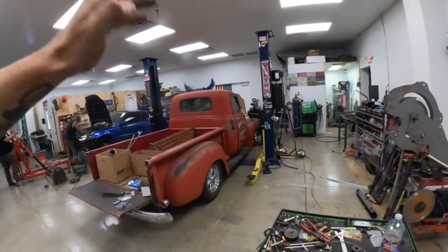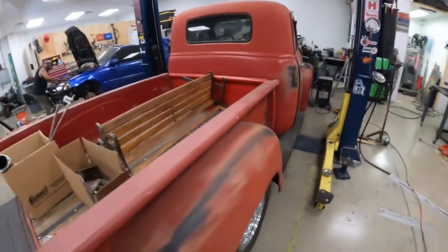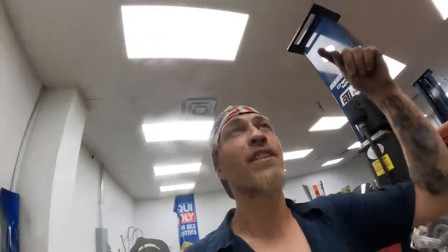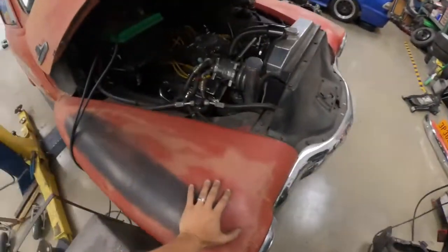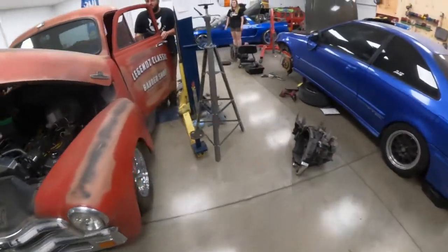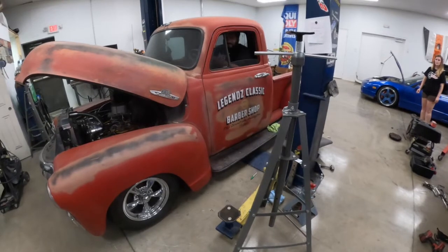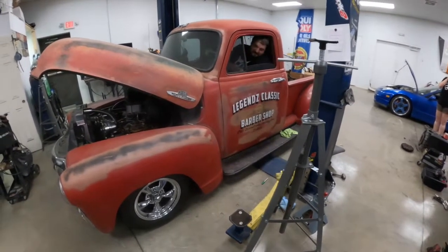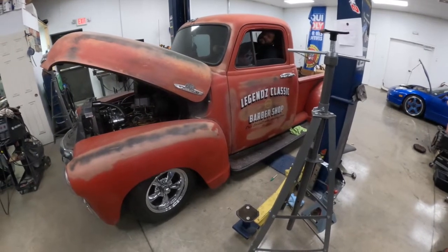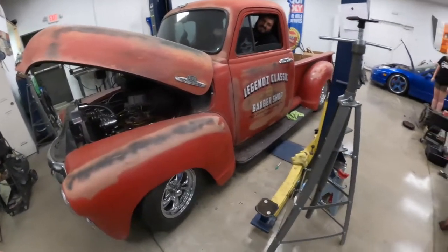Nacho's truck is officially on the ground, sitting pretty much level. I've got a pretty stiff spring in the back but I think it'll loosen up a little bit. I might actually have to lift the spring up one in the perch. The front still has stock springs so it's going to float like a Cadillac up there. Donnie's just dying to drive it. I'm charging the battery. Go ahead — turn it up. That's all you get.